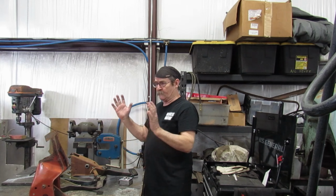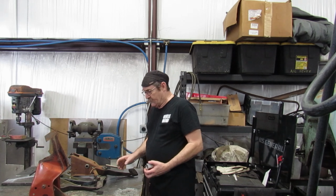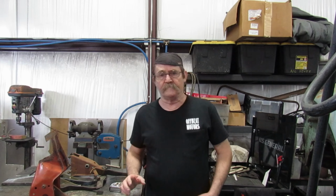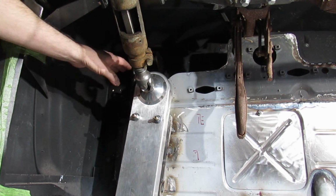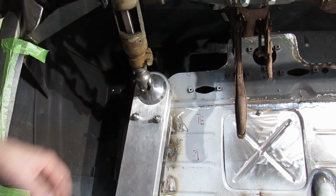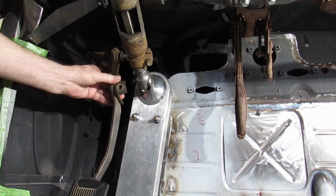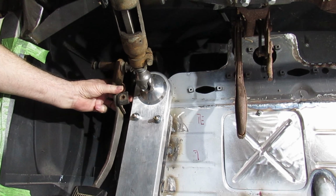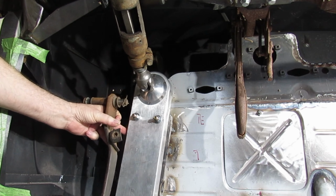We gotta come up with mounting brackets and everything. I'll take you over and we'll take a peek inside the car, and we'll see what we got. Alright, here we are. Now we got to put in a brake pedal here somehow. Master is way up here in the booster. So, we got to have a pedal that'll hang down there like that. But we got nothing to mount it to. And if we come down here,